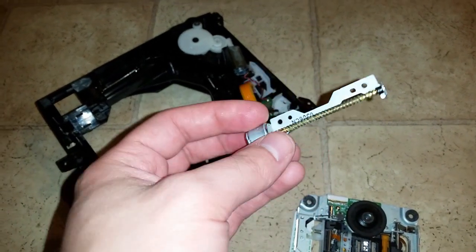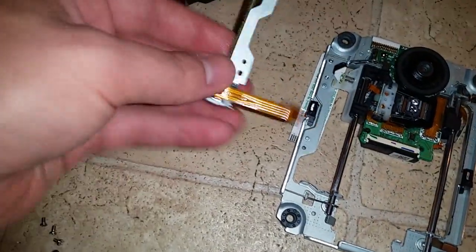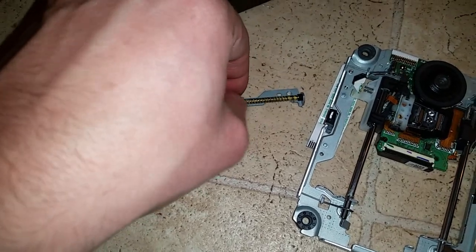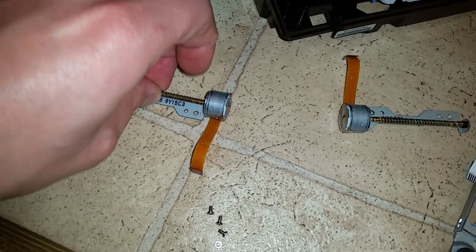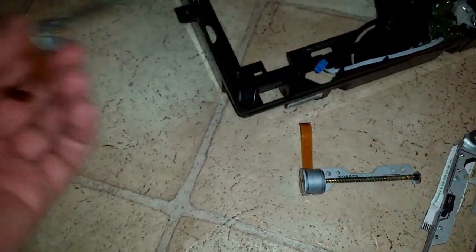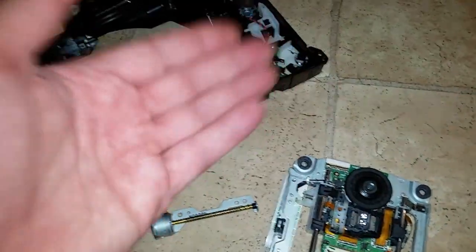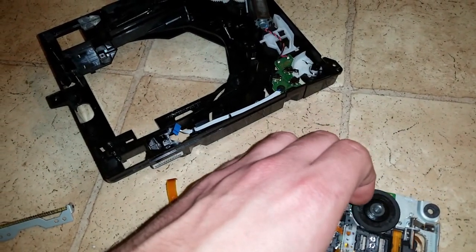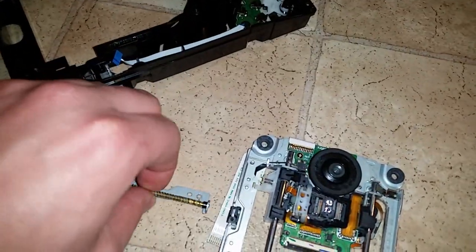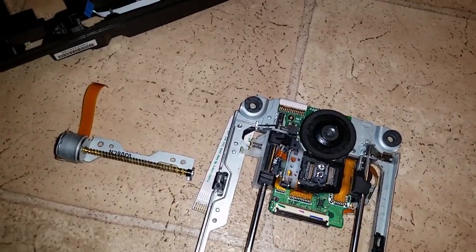After my little discovery in the last clip, I took the drives apart a bit further. To my surprise, you can actually remove just the motor pretty easily. This is the good one from the good drive; this is the bad one. This one doesn't want to rotate at all — there's a lot of resistance. Yeah, this thing looks shot. That makes sense too, because when I started the PlayStation with the disc in, it would sit there a few seconds, pop down and up — it was probably trying to move the laser around, couldn't do it, so it popped up. So I'm going to put the good motor into the bad drive and see if that fixes it.